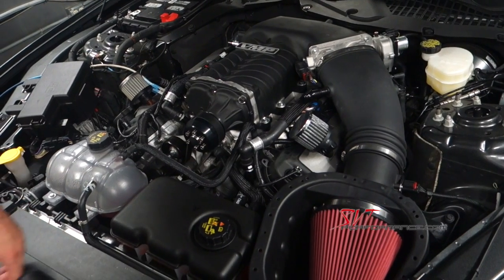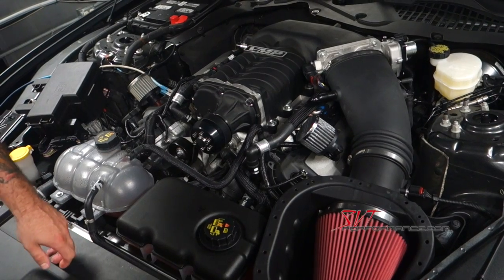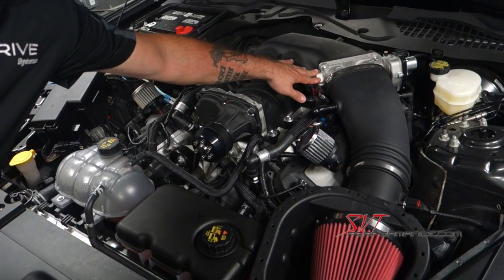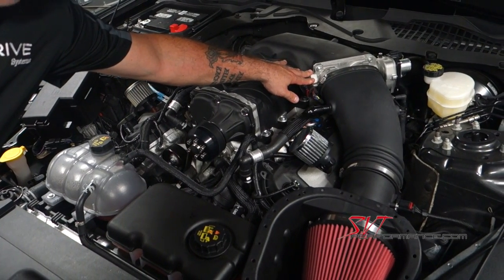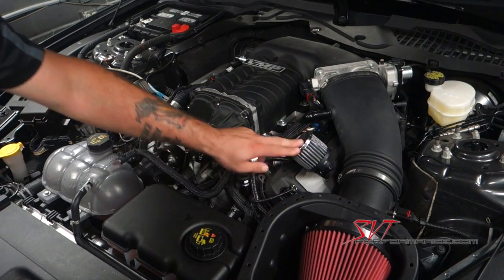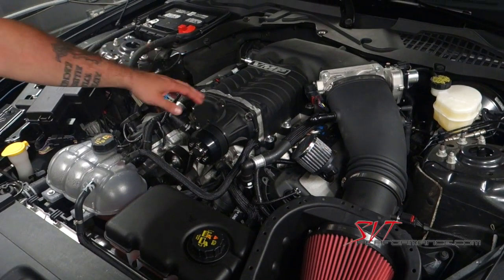We just made 617 here. We will have this released in a value file with enhancements for our transfer function. It will have the throttle body fix in here so you can run the older throttle bodies on here without worrying about a wrench light. We did some variable cam work already, did some of our spark stuff and we accounted for this big boy.